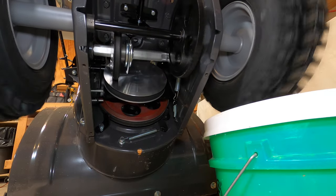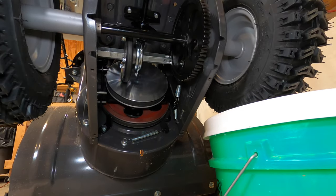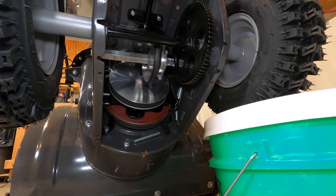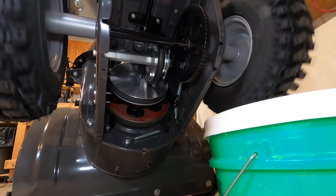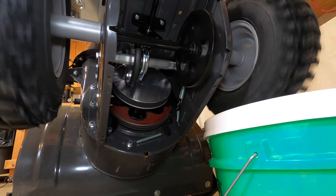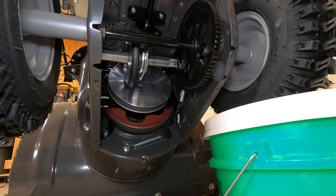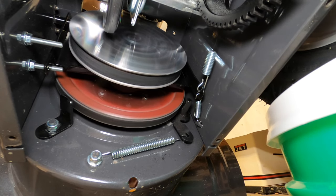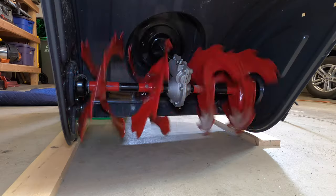Let's shift it now — there's fourth gear, fifth gear. There's third gear. And let's go to reverse — see? It goes to the other side of the disc and the wheels go backwards. Put it in third gear, put it back on the wheel. Let's do the auger now — pull this lever down, it'll tighten the belt, move the wheel, and start the auger moving. And if we let go of the handle, it releases the belt, stops the wheel, and the auger stops.